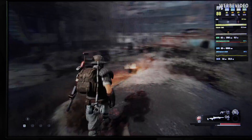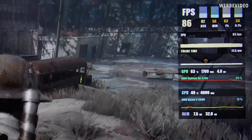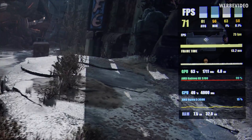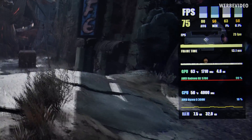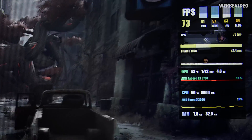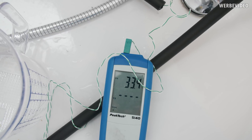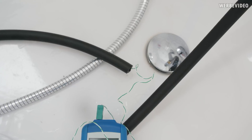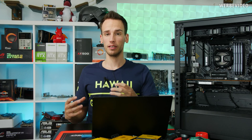After about five to ten minutes of gameplay, the CPU is easily sitting at just below 50 degrees Celsius and the GPU is somewhere around 60 to 64 degrees Celsius — pretty much a perfect temperature for a GPU. By the way, the water is exiting the loop at 33 degrees Celsius, which is an increase of 15 degrees Celsius, and that's due to the very low flow rate.